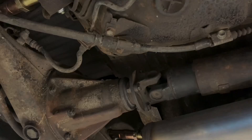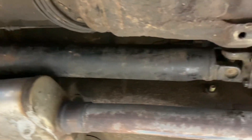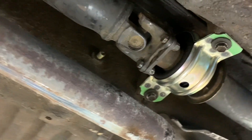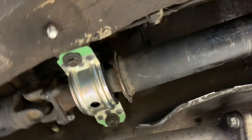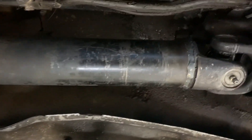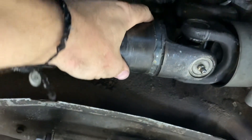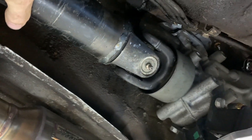I covered this in the second video, but just to recap: for the drive shaft, we used the back section of an AE86 with the AE86 center bearing, and the front half is from an early 80s W-series Celica. This Celica drive shaft has the same yoke as the J160 and just needs to be shortened by about two inches, which can be done at most driveline shops.